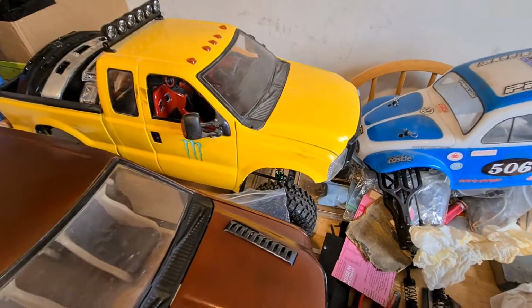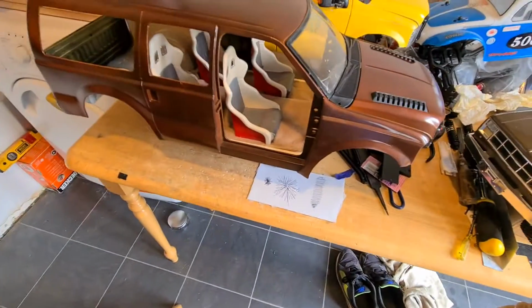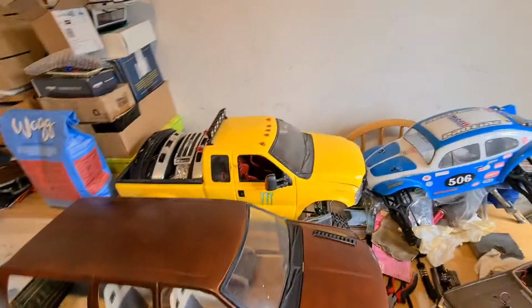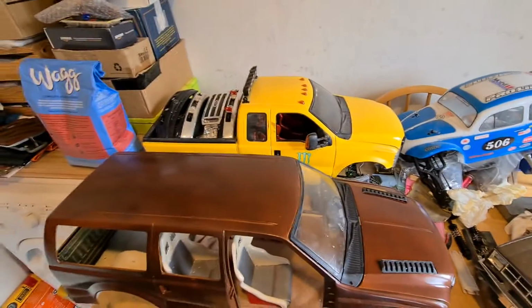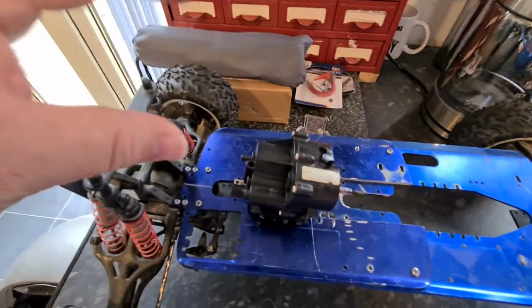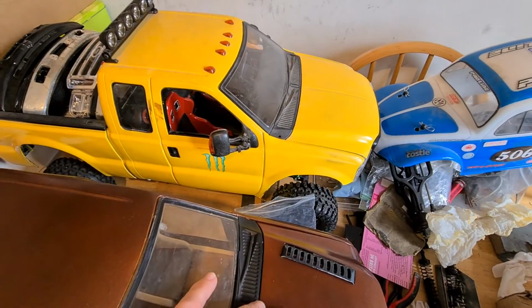But because I've done the solid axle build underneath it with the metal under chassis and the steel frame, it's heavy, very heavy. Now this one being all aluminium metal, the axles will be the heaviest part, and it should be a lot lighter. So yeah, I'm going to nick the running gear from that and put it under that. I need another divorced transfer case for the middle so that one will work, because there's no space for this gearbox underneath. So I need to keep the motor up front assembly that it's got currently. And so yeah, that's where I'm at. That's projects. I'm just going to modify the chassis from that, because at the front end it will just go straight into this.